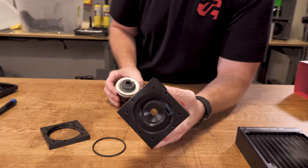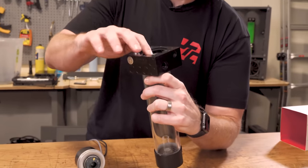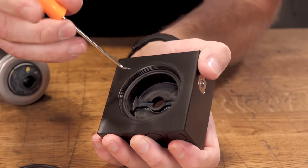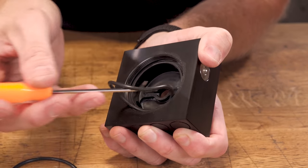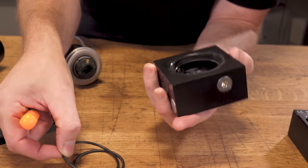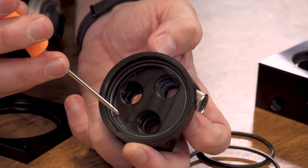We're actually not too dirty in there — you can see there's only one spot on the outlet of the pump that we've got some sediment. That's going to be easy to clean. That's the nice thing about this being acetal: it doesn't leach anything, it's still really clean. I do need to remove the reservoir tube. That O-ring is one that can tend to tear or shear if you over-tighten the reservoir tube. We've got a little bit of dirt in there. There are two different sizes — don't get these mixed up: the small one goes inside, the big one goes on the back side for the pump. We do need to clean the top though — we've got some nastiness in there. And look at all the sediment in this O-ring.